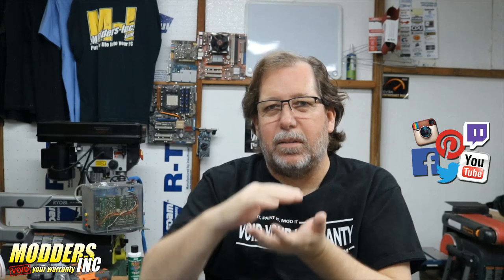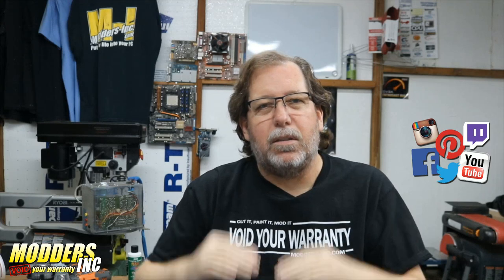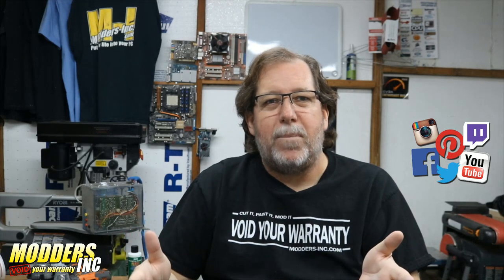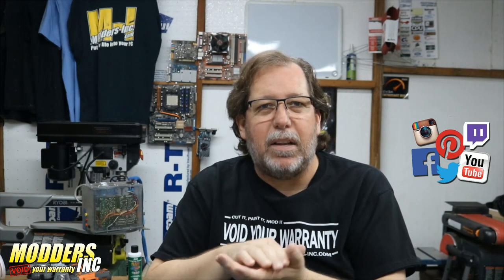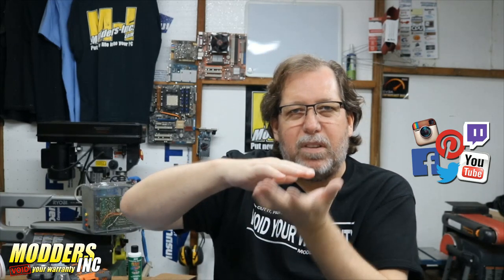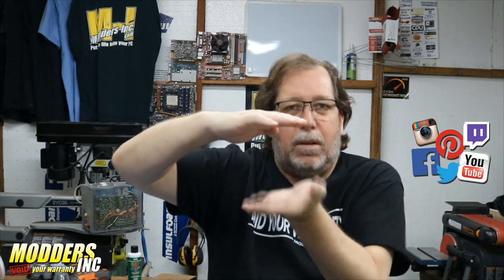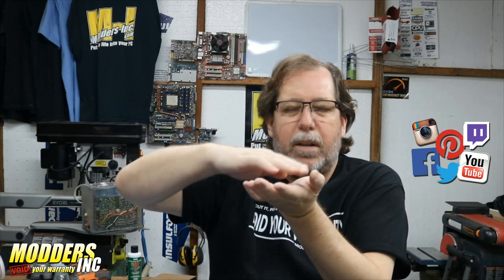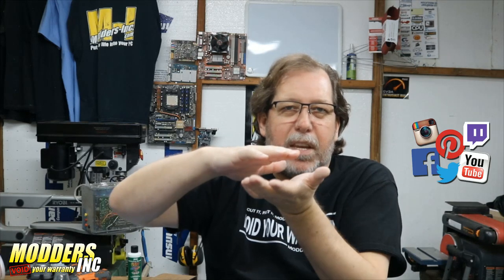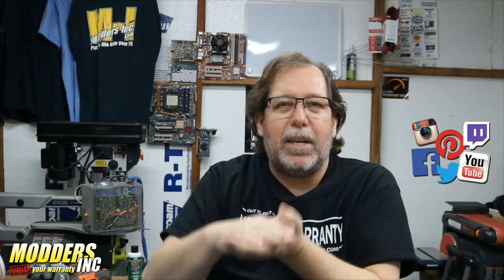The other thing you've got to think about is the thickness, right? Oh, more must be better. Actually, it's not. You want as little as possible to spread as much as possible. And why do I say that? Because the thermal paste can actually act as an insulation. It can be an insulation barrier between the CPU and the cooler. So if I had this much between the CPU and the cooler, how do you think it's going to transfer the heat? It's not going to transfer the heat well. But if I had very little, it'll transfer the heat right from the CPU to the cooler much quicker. That way you can dissipate the heat.